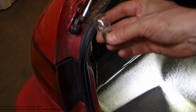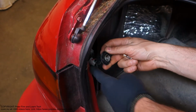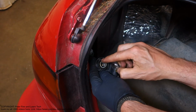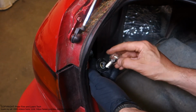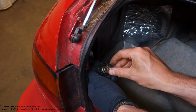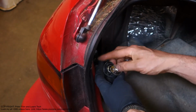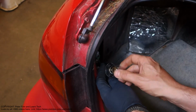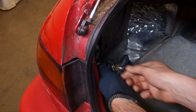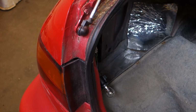Okay, now I am installing this bulb back. I take this cover, and I take the bulb in my hand and press it in here. Remember there are those holes where I insert this metallic tab and heels, and it goes in there. Then press down and rotate, press down and rotate. If it doesn't go in, the trick is that the bulb is in the wrong position. I need to rotate it this way and press again. Now it went in there. This is the trick. Then we only check that this bulb is tight very well, and then carefully we insert it in this position.